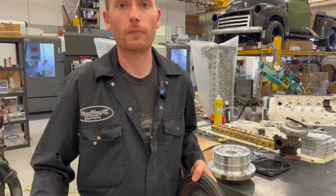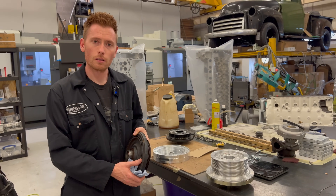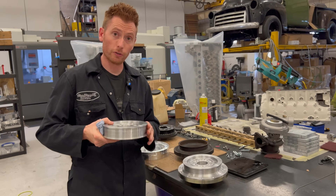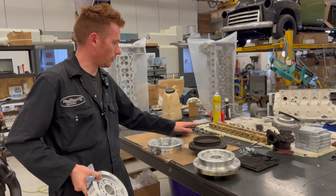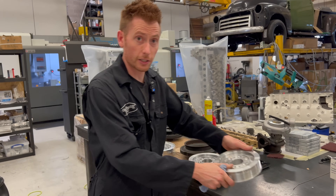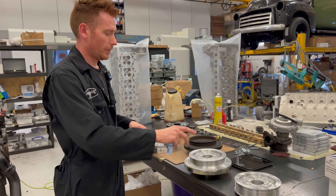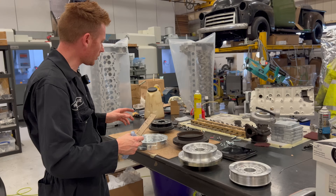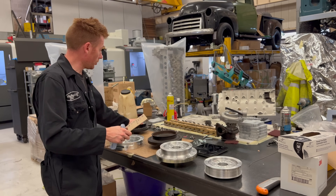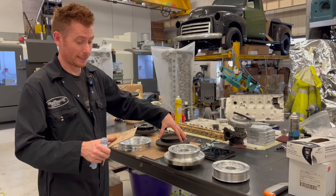Going around to the other side — why do you need multiple layers? Well, the additional layer is just for the supercharger. If you're running a normal setup, you just have the single pulley like those two. If you want to run a blower, you add the extra one on. Let me tell you the weights: my scales only went up to five kilos so I had to split things down. The original pulley is 4.2 kg.